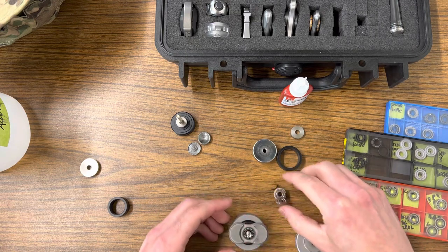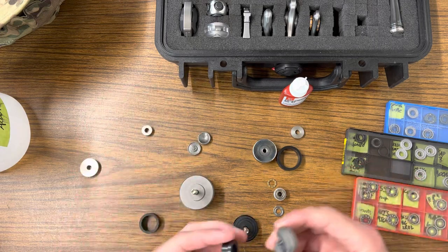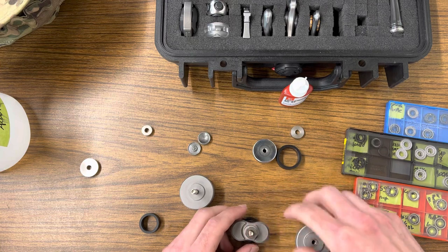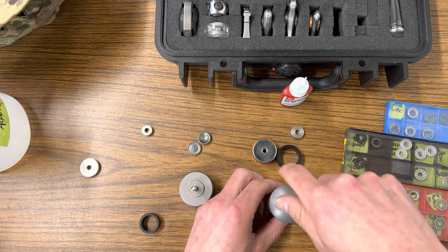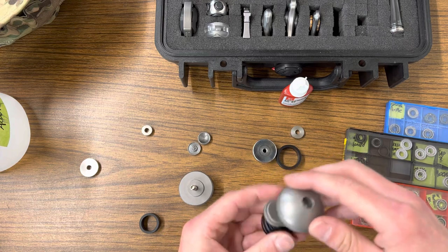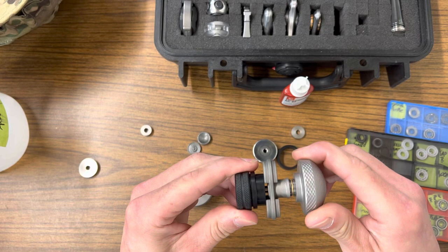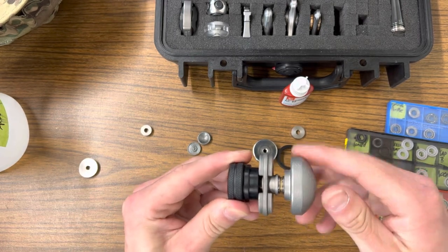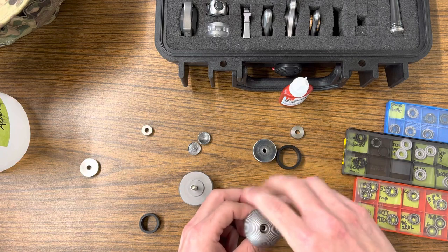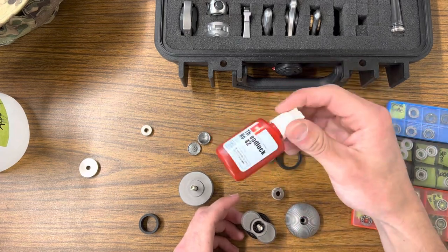It's because the torque bar mini is so small - not enough thread engagement. This is why I have two tools. It's a good idea to just cinch it down, look it over, and make sure everything is lined up properly before you actually torque it to press the bearing out. I don't know if you notice how easy that was. I've had that bearing in there for easily three or four months, and I rip pretty hard doing the spins. This is what I use and it hasn't come loose.